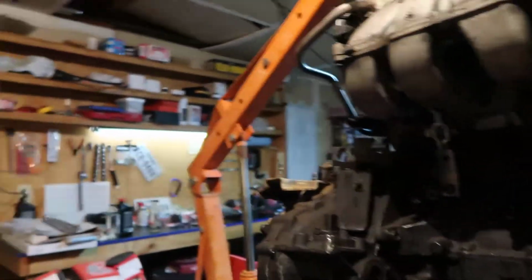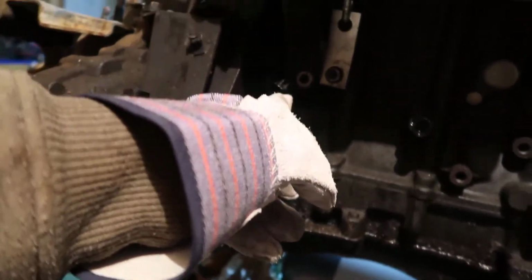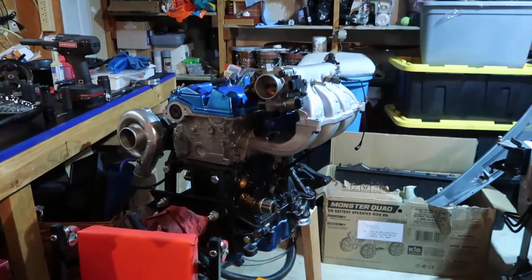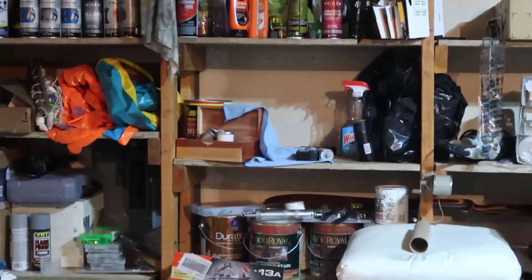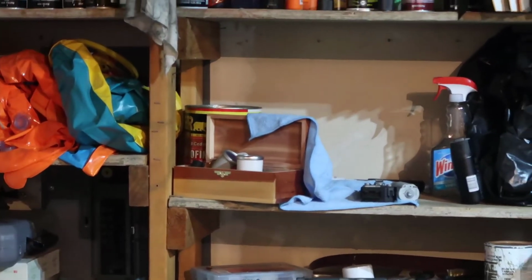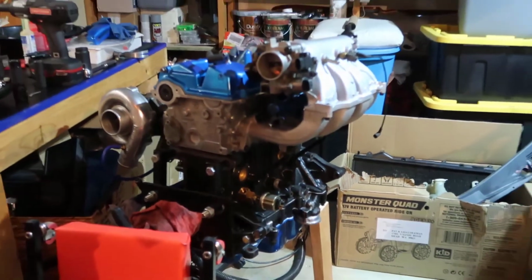I'll also prepare, because I'll need to install the oil sensor, the pressure sensor. And you see on my engine right there, I have that big thing. That's for the cluster, the gauge to work. So see the gauges right there. Yep. For the oil pressure gauge to work, we need to have that little thing in there, and then put the sensor on top of it.